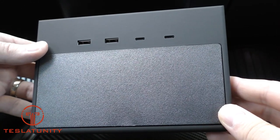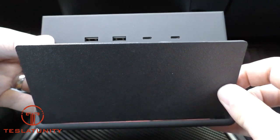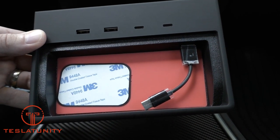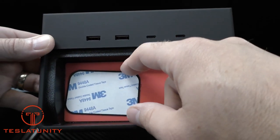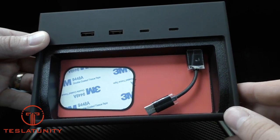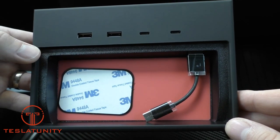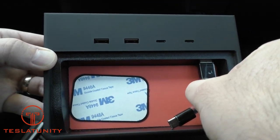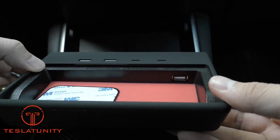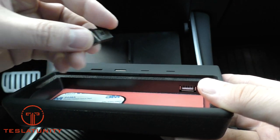You'll notice there's a secret compartment. Push in on either of the corners in the bottom to open it. Remove the door and you'll see a magnet with double-sided stick tape on the other side. That's there in case you want to use a solid state drive for your Tesla cam backup storage. In my case, I use a really small and inexpensive SanDisk thumb drive — I'll have a link in the description down below, you can pick one up on Amazon. If we remove the USB cable, you'll see there's a hidden additional USB Type-A port, and that's where we're going to plug in that SanDisk thumb drive.